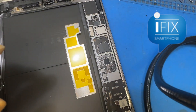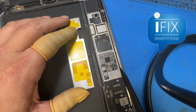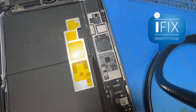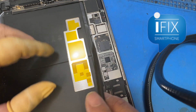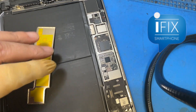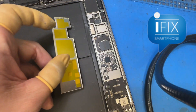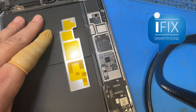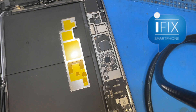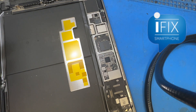So if you have an iPad 7 that's working and you want to prolong its life, you can apply thermal compound — just like the thermal compound you use on a computer heat sink. Put that on there, stick it on, put the cover back in, and it'll spread the heat evenly. I've done this on a couple of iPad 7s whenever I had a chance to replace the screen while it was still working, and those never came back. It's showing that it's pretty effective.